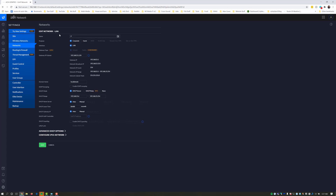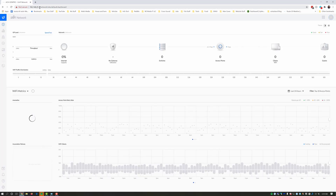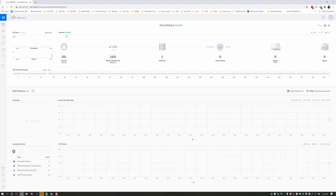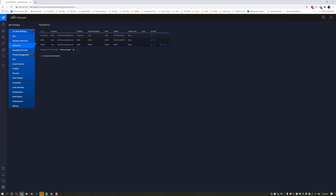The first thing we're going to do is change my internal IP to match what I use internally. We're going to update the DHCP range. I use 192.168.25 as my internal production LAN, so we can call that 'production.' I change my DHCP range, and I'll also put in the UniFi controller IP. Click save, and there's our network with the new IP I gave it.